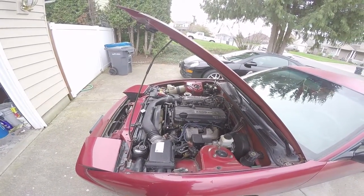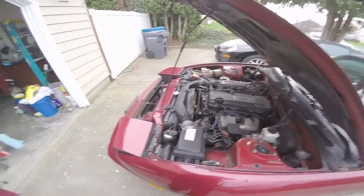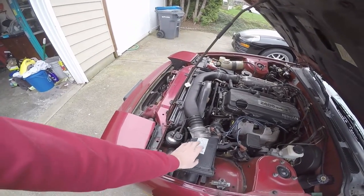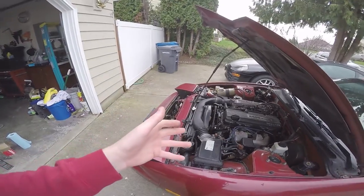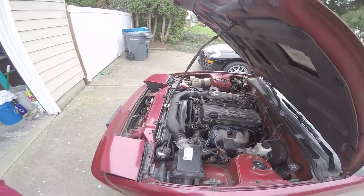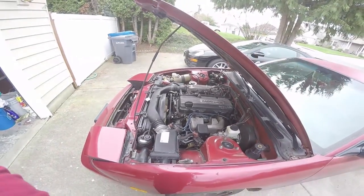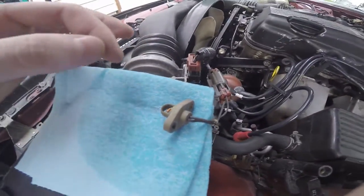Kind of curious to see how they look. It does backfire through the intake - we took the intake off and it's just black on the engine side, but nice on the filter side. So it is backfiring through the intake. Hopefully this fix will help sort that out. If not, I'll get a timing light from AutoZone and check if the timing is too retarded or too advanced.